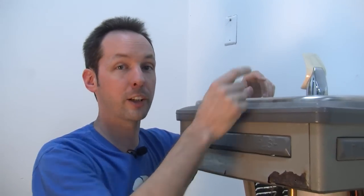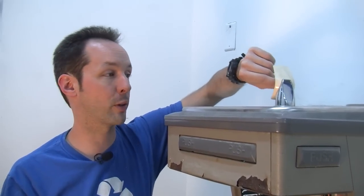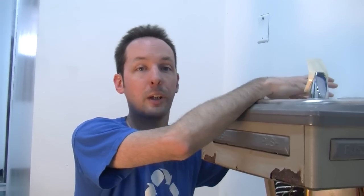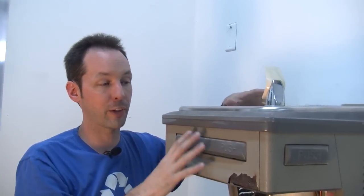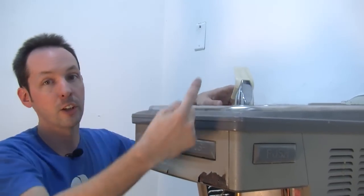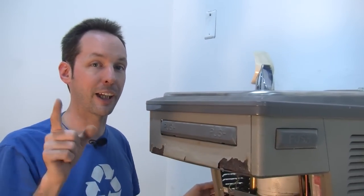And there can't be any way, like if you put a hose on here, permanently attached a hose from here to fill buckets and stuff, and that just set up here when not in use, that would actually be against the law, because if the valve turned off or malfunctioned and the water turned off or something like that, this could backfeed dirty water out of the drain and that contaminates the water supply, and that's bad.